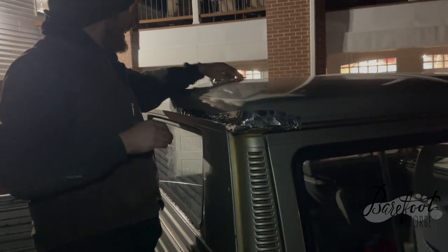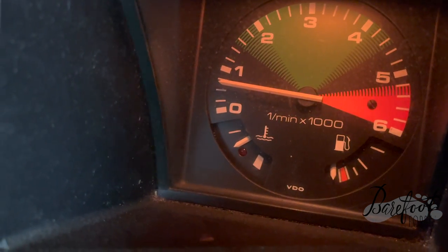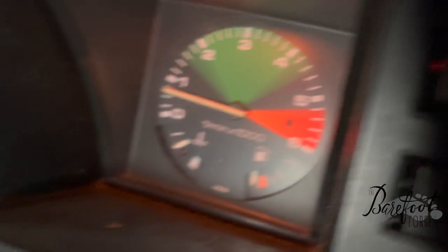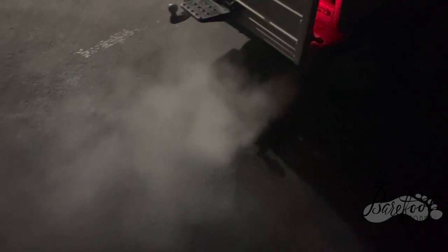She's running a little hot. We've got a high needle here. The fans aren't coming on. She's right in the middle — no that's high, she's high. The fan's not coming on. That's looking more and more like a head gasket. This is fully up to temperature and it's still doing that — so it probably needs a set of head gaskets.